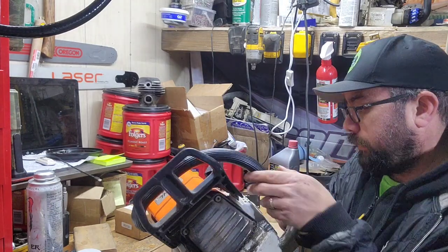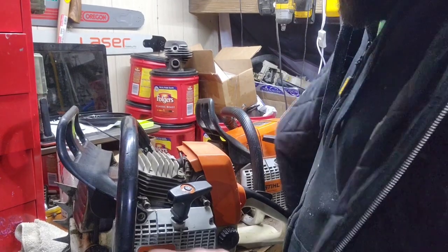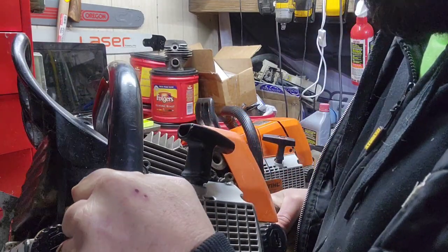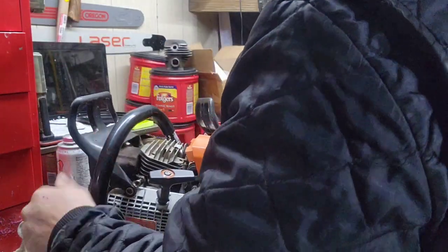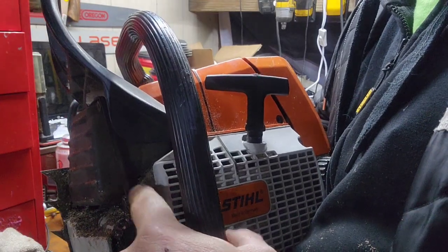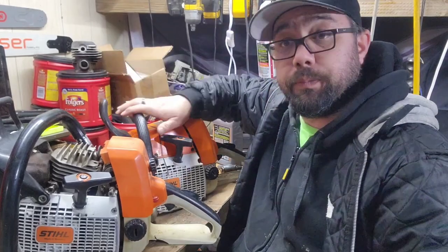This is supposed to be a 12 mil. Between me and buddy Evan, we've been discussing this — this is a 10 mil, but the cylinder has been replaced at some point because it's not a slant fin. There's a divot right there, and that divot is supposed to represent a 10 mil wrist pin, whereas this one does not have that divot, so this one is supposed to be a 12 mil wrist pin. So we got some potential things for this one.